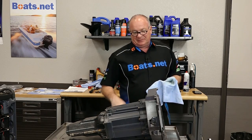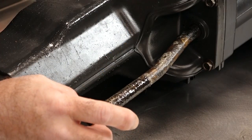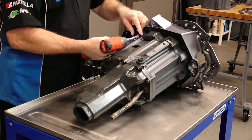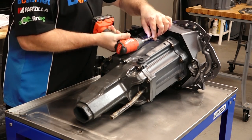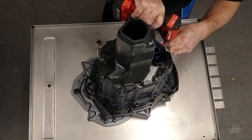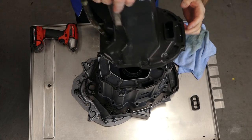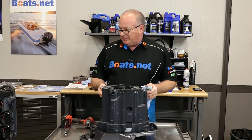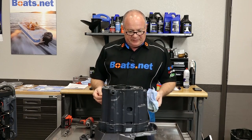For the most part, all we're going to need from here on out are the bolts, but we'll go ahead and break it down. This pickup tube isn't looking too good, but we'll go ahead and pull it down. It looks like they've done it correctly so far, but I don't like the fact that they reinstalled a corroded pickup tube. We are going to go ahead and replace it.